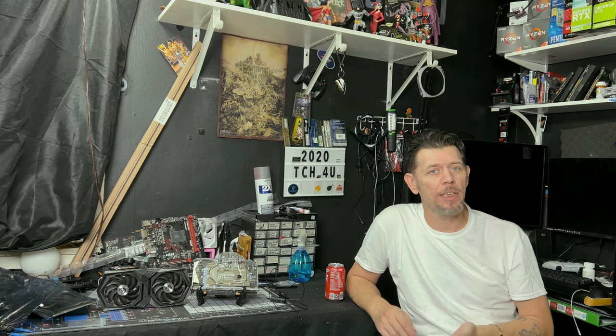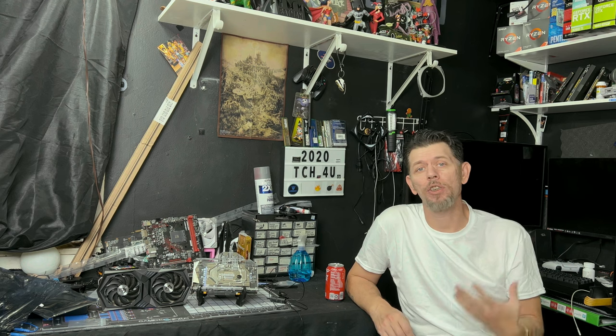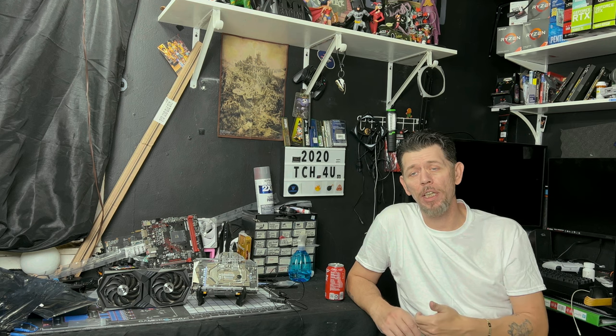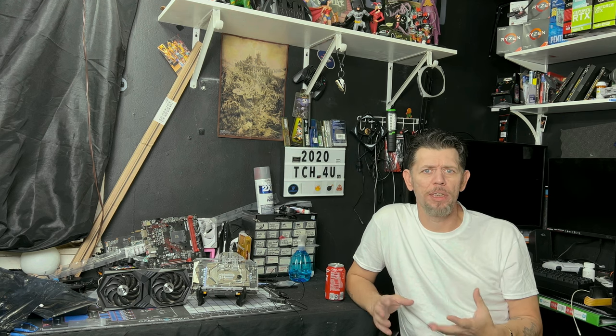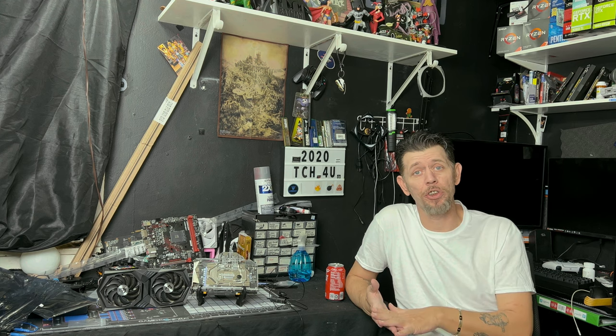Again, if you didn't have the same exact block, you still could kind of follow along, just paying attention to where I was putting my thermal pads. If you bring up the instructions to the one you're looking at, this is still a video you should be able to get a little bit of tips and tricks from as you're installing your water block onto your GPU.